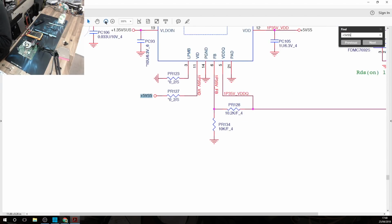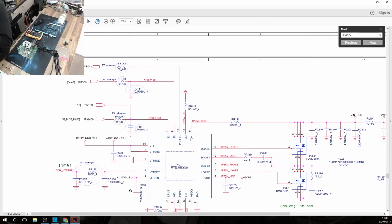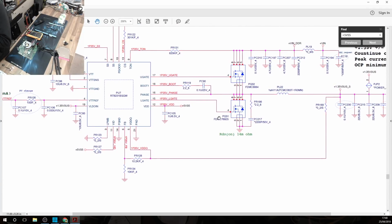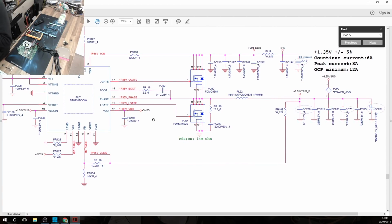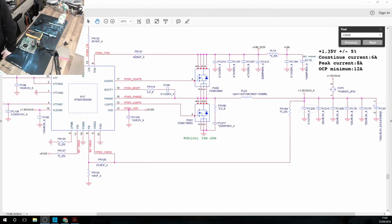Okay, so here it is powering something. Where are we? What is this? What am I looking at? DDR3. Okay, interesting. So we've got another power system here. This is the DDR power rails. Now I checked on these and they were not shorted. So what else does this rail connect to? So there it is again, same deal on there.